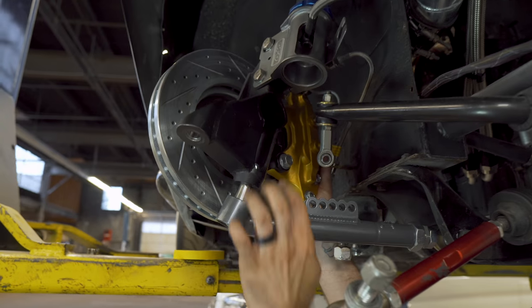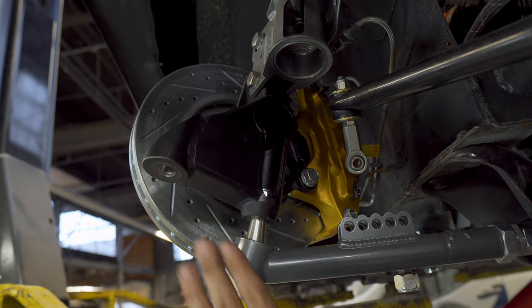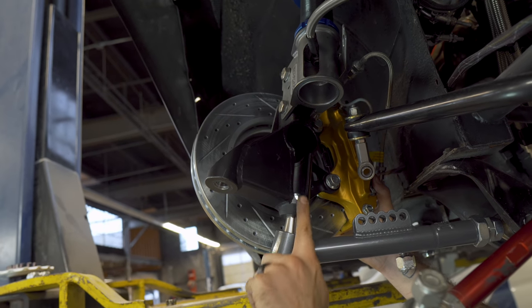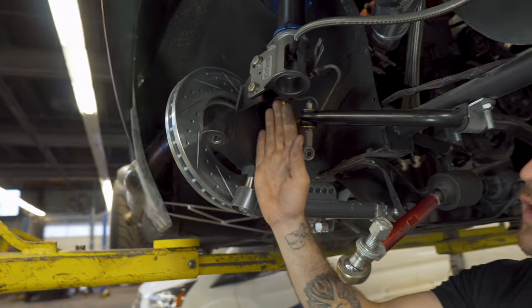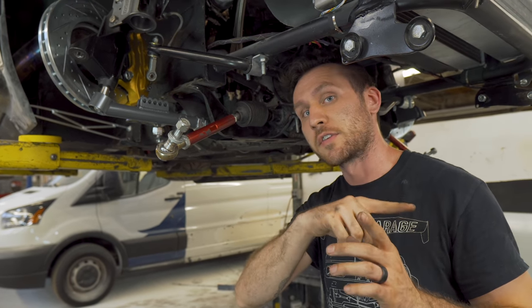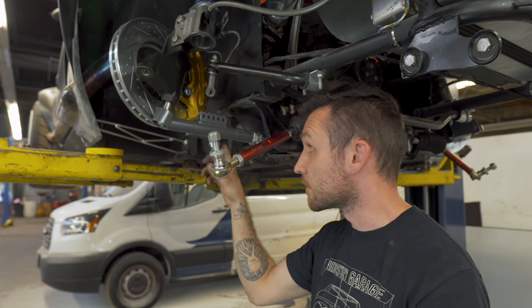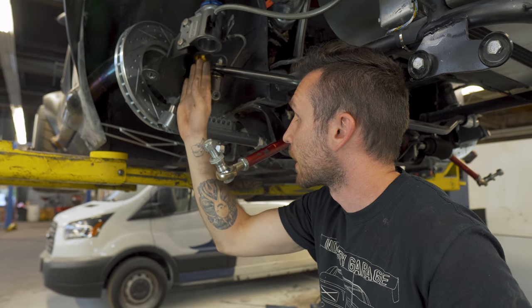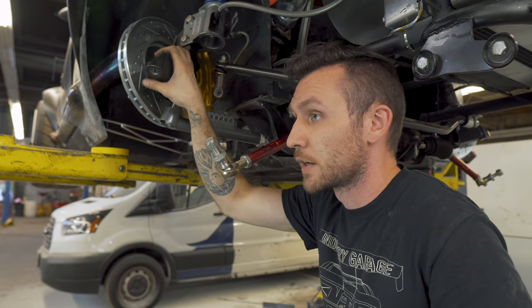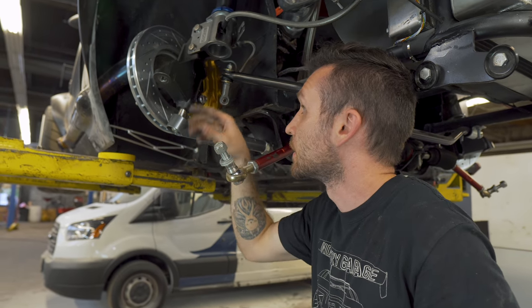These are GK Tech knuckles. They're nice knuckles and do exactly what I need, but if you look inside here, this channel — you have to fish a socket down there and then fish a little extension. It's really annoying. But the nice thing about these is the pitch of the ball joint where it actually bolts into the knuckle on a stock S14 is actually slightly offset, and on these it's actually direct center. Since I'm running the front left knuckle on the front right — basically swapping because the tie rod pickup points on S14s are supposed to be behind the lower control arm and they actually have their tension rods running forward — it's flip flopped from S30 suspension. These knuckles are designed for drifting, so they might have a slightly quicker turning radius, which is okay because S30 racks are a little slow.